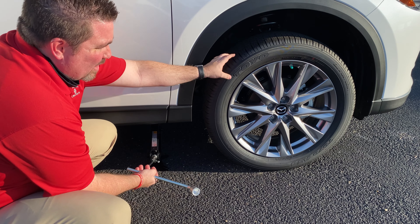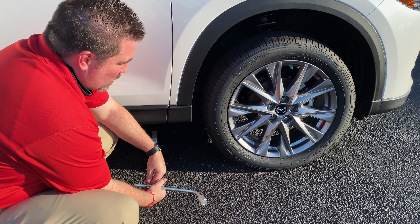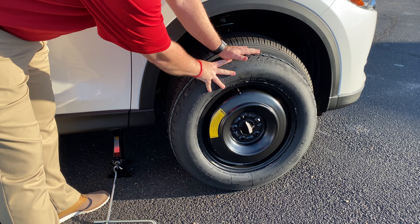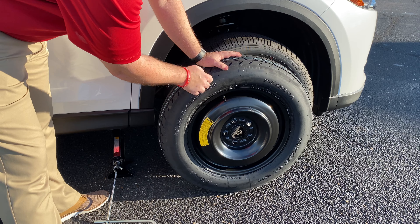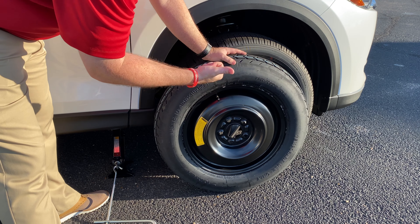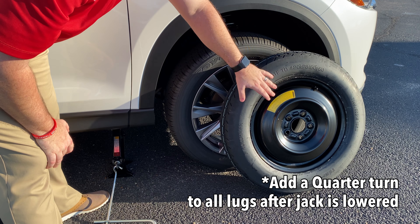Now in the event of a tire being slack, blown out, or flat, you're going to have to lift it higher than its current position to get the tire off, so that way you can put the temporary on. Now you can see that this temporary is the full height — so if this was a 17-inch tire, it'd be the exact height of that 17-inch tire. Still safe to drive on, of course at low speeds. It does have a high PSI because it's a smaller tire, so take all safety precautions, low speeds and short distances. It's basically designed to get to the next location — dealership, tire store, whatever the case may be. Once we have loosened the lug nuts and removed the flat tire, everything will match up and you'll tighten them up with your tire tool.